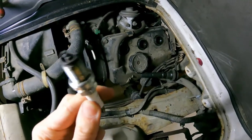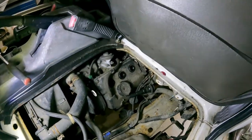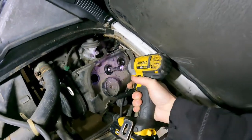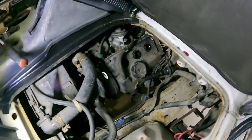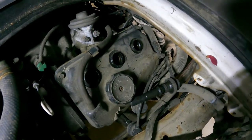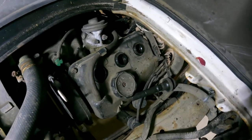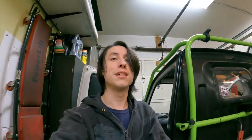Pulled number one to have a look and it was soaked in gas, so I know the engine's flooded. Now I've run into something doing this by hand. Number three is doing it too — the spark plug is turning but it doesn't come out. Neither two nor three will come out. That can only mean the previous owner cranked them down so tight they stripped the cylinder head. So I'm guessing that's probably why it's not starting — it probably has no compression in two and three.